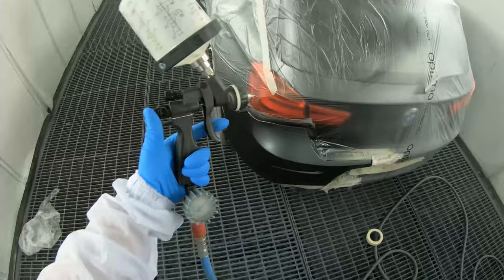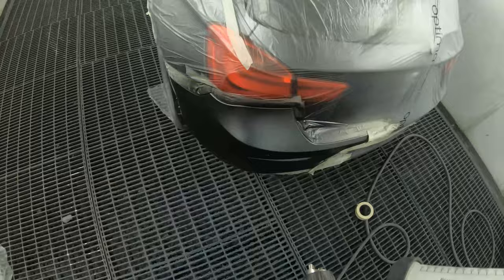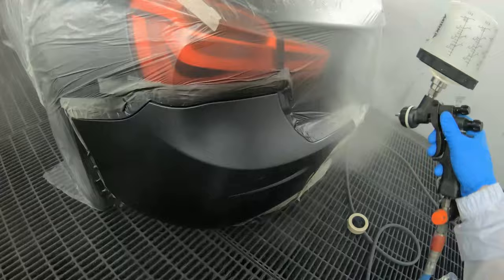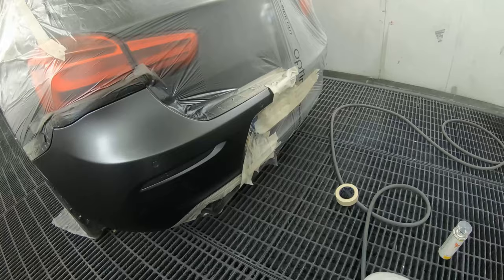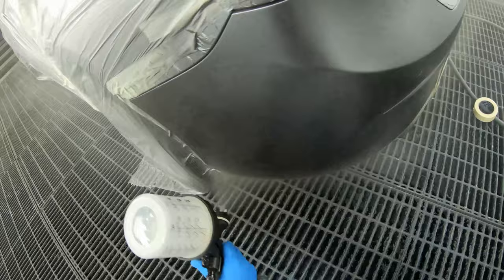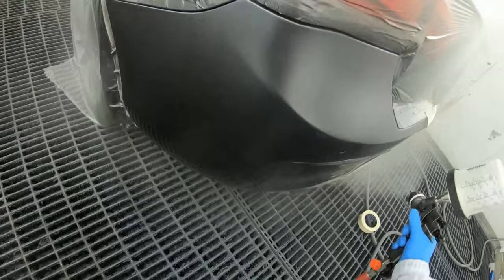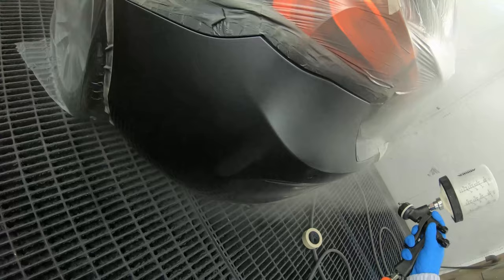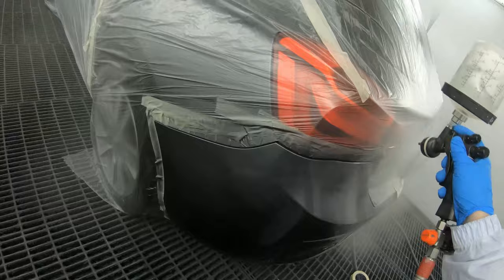Lacquer time. Same setup as usual — HTE clear, 1.2. I'm going to do the grip and rip style I mentioned in one of my other videos, just to show you something different. That's your first coat — your gripper. Nothing fancy. I am going further than the base and then I'm going to pull that off to put the fade-out on after. That's as much flash as your grip coat needs. Now this is my final coat — my wet, my grip and rip. I'm going to try and angle it just to try and keep out of that loop as much as possible.